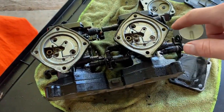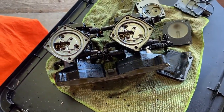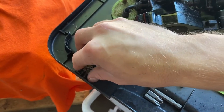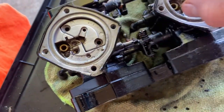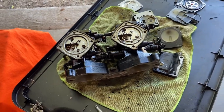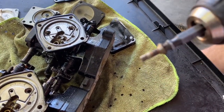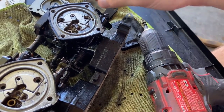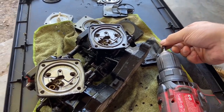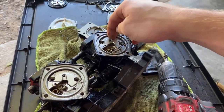We are five out of six for non-stripped screws. This one was just super rusted and instantly stripped out, which kind of sucks. But we should be able to hit it with the easy-out and get that one out. These are all pretty grimy overall. Just like that — easy-out putting in the work and we got that stripped screw out. Now I have all the screws out and none of them are stripped except for that one, which is pretty rare with these carbs. Now I can take these off and start disassembling them further.